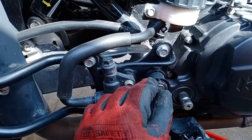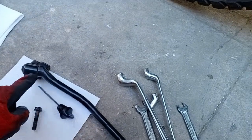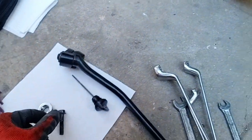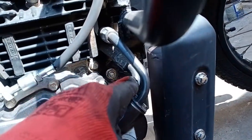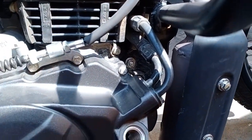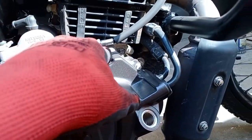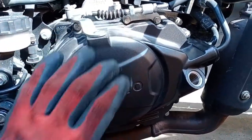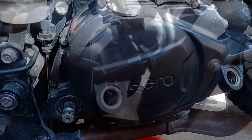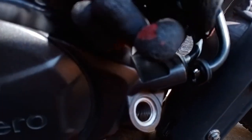This is a swing arm bolt — I have taken out the swing arm nut and the kick lever bolt. Now I need to take out the oil cooler pipes, then slowly remove all the bolts to remove the crankcase cover. The oil cooler pipes are now pulled outside.